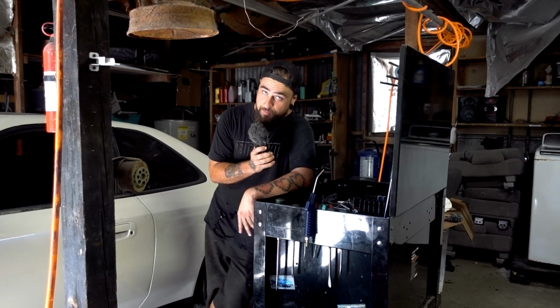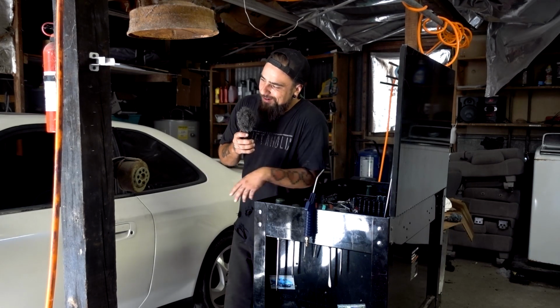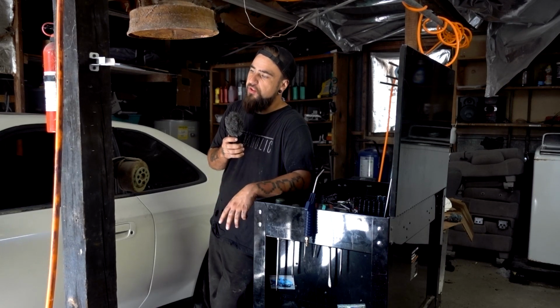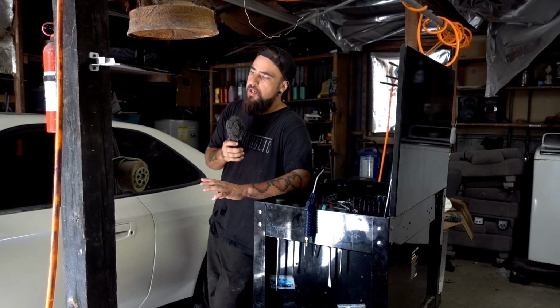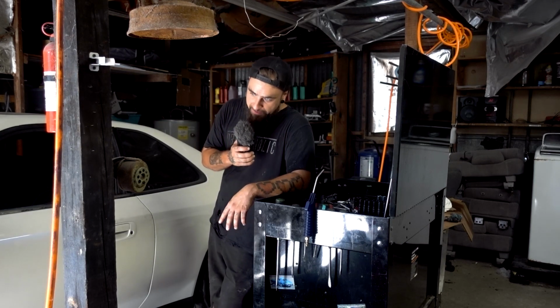Well, the Honda isn't going to be leaving anytime soon, which is not a bad thing. But my concerns are a reality. A little bit of context for you. In one of my previous videos, I mentioned the block having some scuff marks and the fact that the block wasn't machined, but the head was a concern because with the metal gaskets, as I've mentioned before, if both surfaces aren't completely flat, then it won't seal properly. Well, that's what's going on.